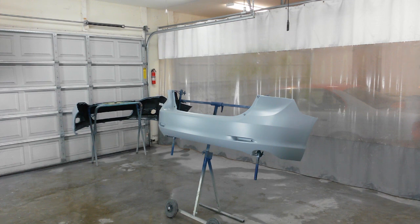I'm going to go ahead and tack it off again. It's only been curing about 30 minutes, but that flex additive I don't think slowed the cure time all that much. I only used about half as much as you can possibly put in there. I think it was 1.5 ounces per pint. I used about half that. I don't want to go to the full max on this experiment here. But that should be enough to at least give it some flexibility. I'm going to go ahead and tack it, and I'll get to spraying.